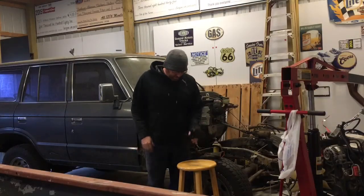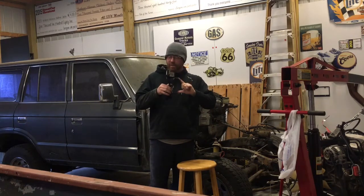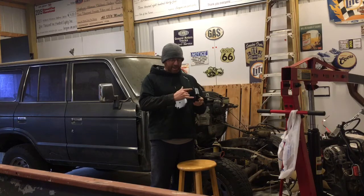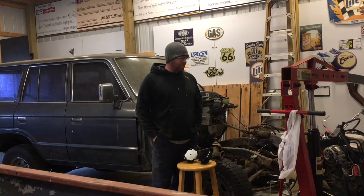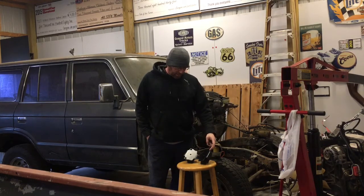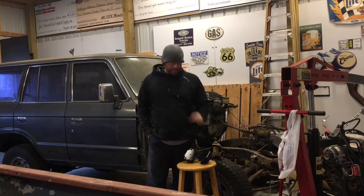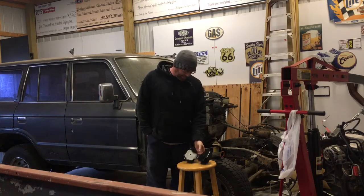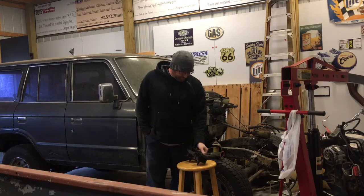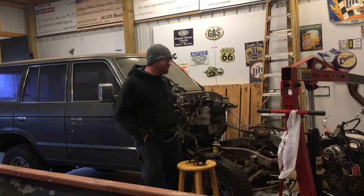Didn't show the last part there because I've got a little frustration here. This piece — these fit the hole just fine for the crossmember, but I can't get these holes to line up on the transfer case. I'm going to see if I can mess with it a little more on Tuesday or Wednesday night. I'm going to try and mess with it a little more before I call the company and send it back or figure out how to make it work. The problem is it's about this much — like everything else on this damn thing has fought me — it's just a little bit different, a little bit further than it should be. This piece is for an 88 to 89 transfer case mount and I don't know why it doesn't fit.